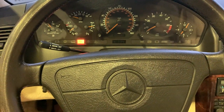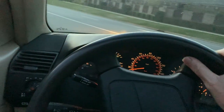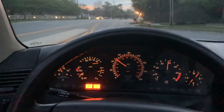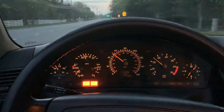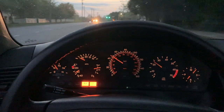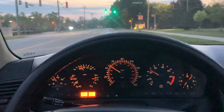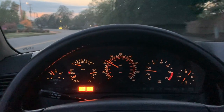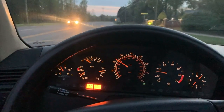I'm going to give it the beans while not totally wrecking the thing. Foot to the floor — it's just not as fast as it should be. It's pretty quick, but not what it should be. I think the O2 sensor is totally bad. I also need an alignment on this thing — I think the U-Haul trailer torqued up the steering somehow. Now in fourth gear, cruising. I also need to figure out why these fans aren't turning on — that's a huge problem. I hate the car warming up without them.